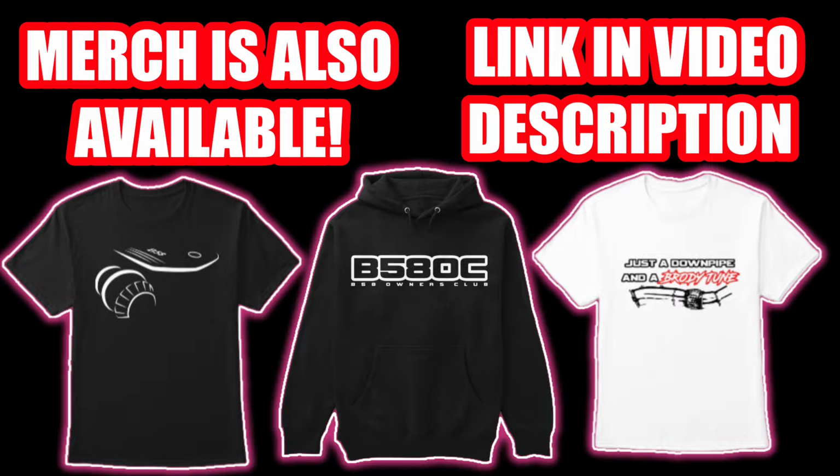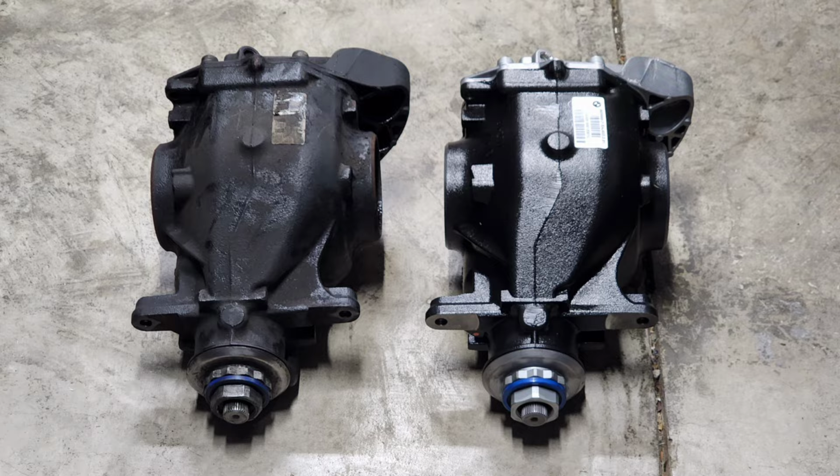So the first and probably most important update that I've done is I installed an M Performance LSD, and this is really going to help me get out of turns quicker, allow me to get on the throttle sooner, and hopefully prevent that inside wheel from spinning every time I try to accelerate out of a turn, because that was by far the most frustrating thing.